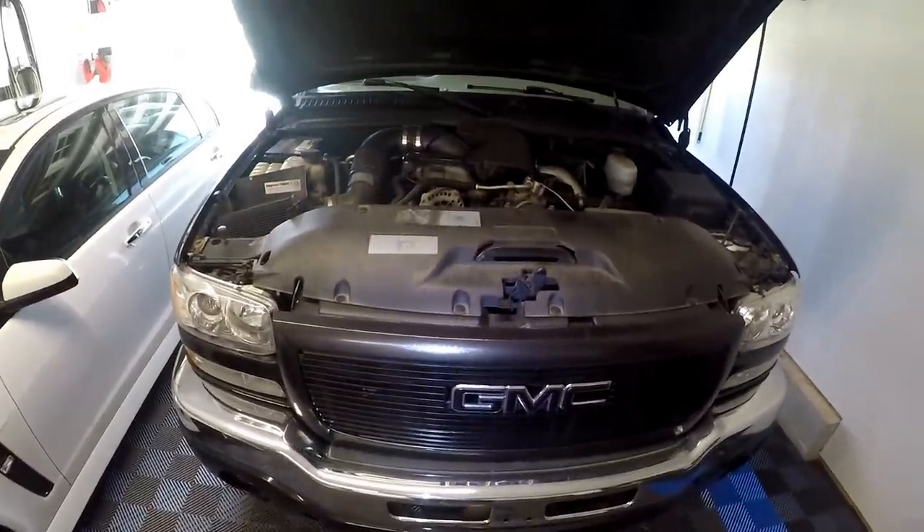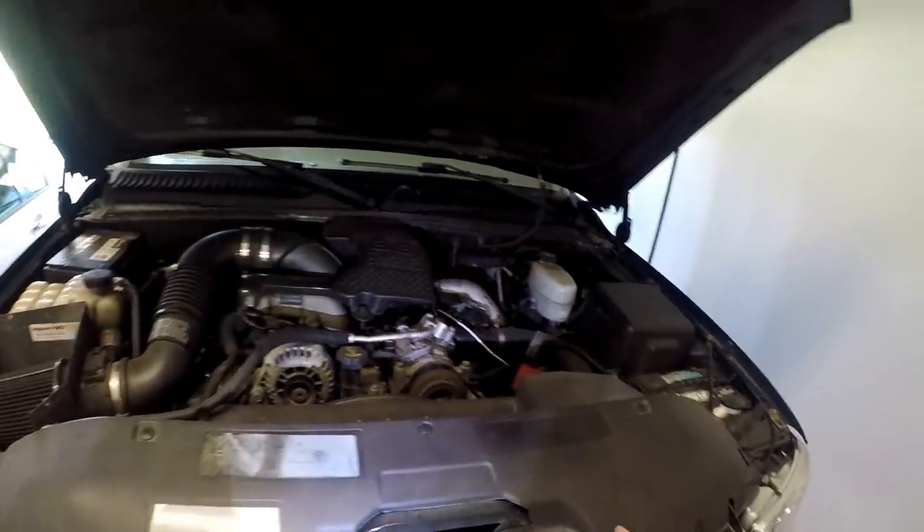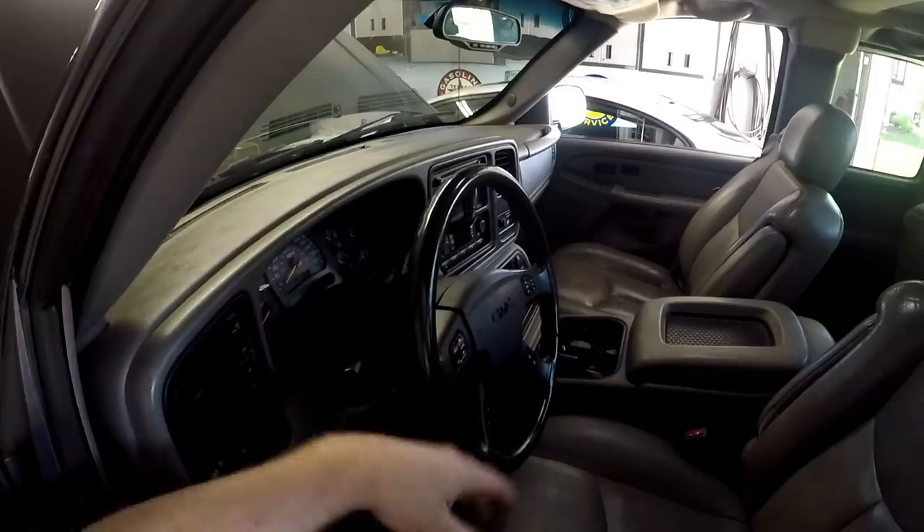New sensor is in place. Plug the harness in — harness went in. Then seat that security tab and slide it in behind the connector — there you go, all the way in. So that's about it. I just finished the sensor replacement. Now I'm going to hook up both batteries — put the negative terminals back on and then get in the car and fire it up.